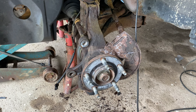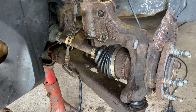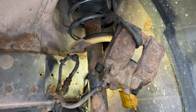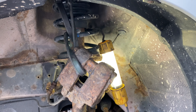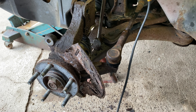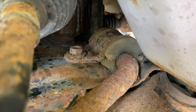My 2008 Ford Escape has over 125,000 miles on it and many of the front suspension parts were long overdue for replacement. There was noticeable rattling going over bumps, the bushings for all components were cracking and leaking grease, and the hub bearing was failing with a constant hum. I opted to replace much of what is seen, but use your own discretion if you plan to attempt a similar repair.